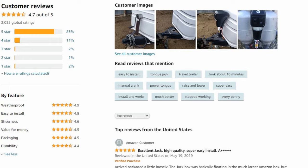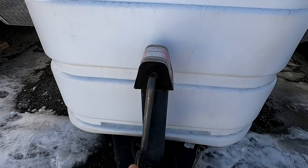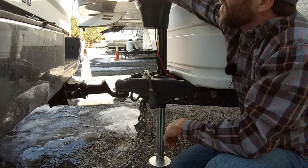The reason I'm doing this on our camper is because our manual hand crank jack finally broke. I've repaired it multiple times over the years and now the gears have actually ground down to where it's almost impossible to jack up the tongue jack. So we were faced with the decision of whether we replaced it with a manual tongue jack or electric. And since electric is what's going on pretty much all campers these days, we chose to go electric.